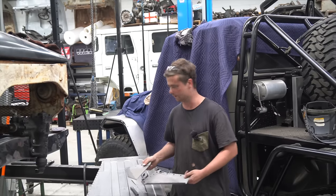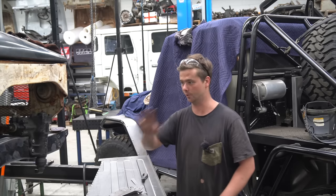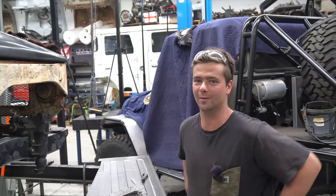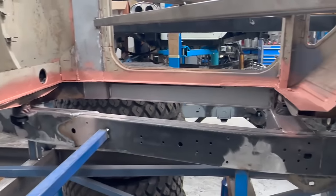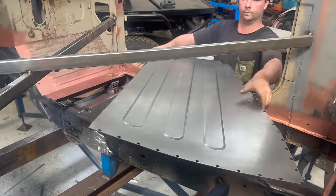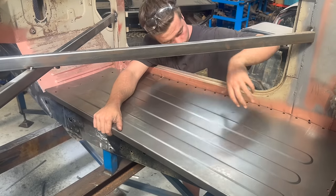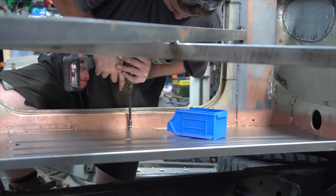We're going to put some floor pans and the tunnel kit into George's car. We're not fully welding them - just going to tech screw them in until we get the engine and gearbox position perfected, and then we can weld everything off at once once we're confident with the fit. Connor had removed paint and added weld through primer to the surfaces that the floor pans would be plug welded to. When the old floor pans were cut out there was a lip which remained around the edge of the cab. You can see there are plug welding holes which the laser cutter cut out around the edges of the floor pan which will align with the lip. Connor is using screws to temporarily hold everything in place.